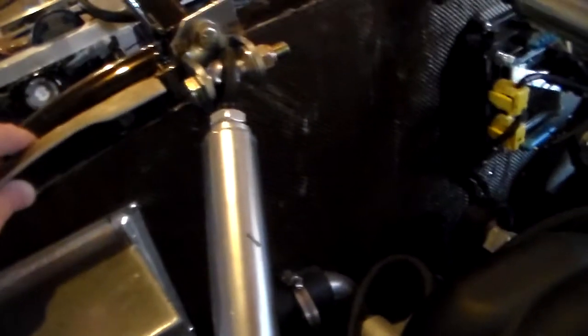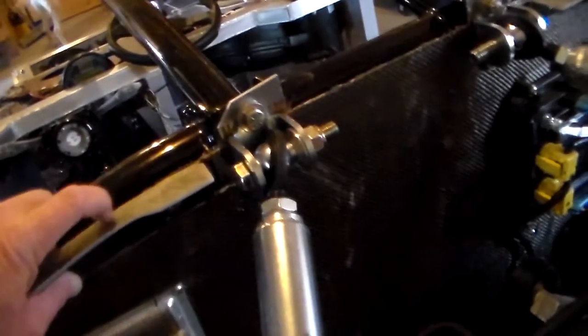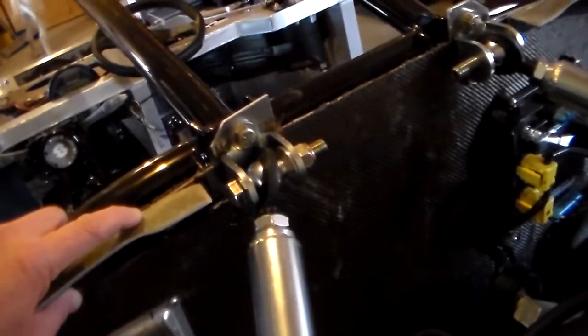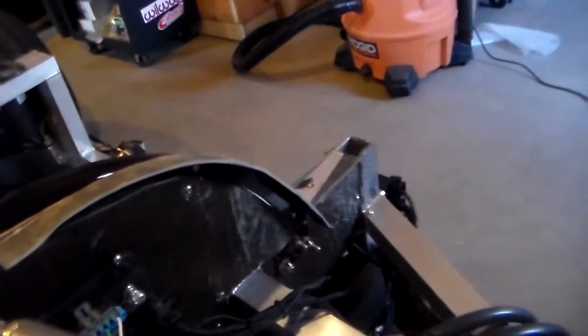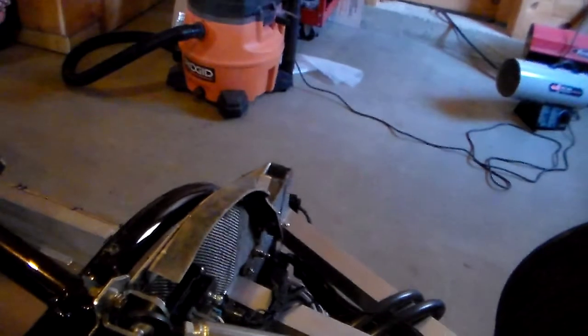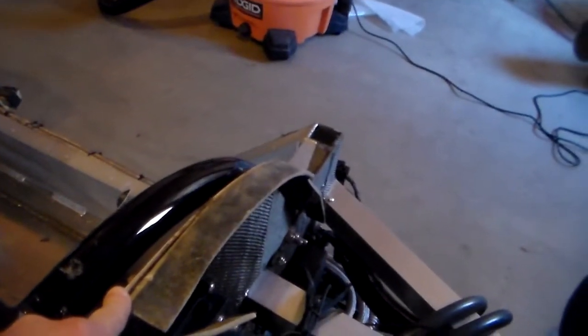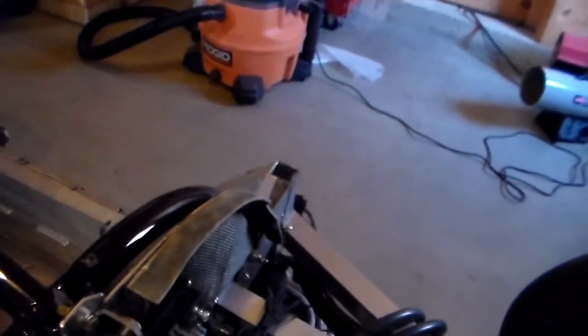The top of this panel will actually touch the body — you can put a little foam rubber gasket in there or some silicone if the body is going to be on there permanently. If you look over at the passenger side, that one's already bolting on there, and that will provide more of a surface for the body to sit on. It also won't be sitting on the aluminum edge, which doesn't provide much surface area. Instead it's going to sit firmly on this and make a better seal.